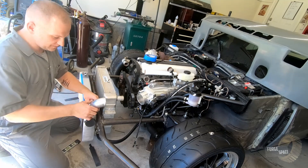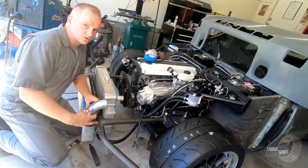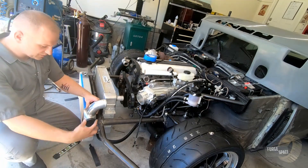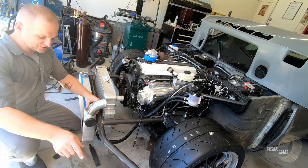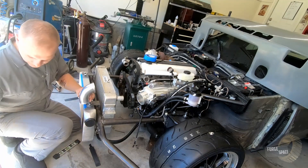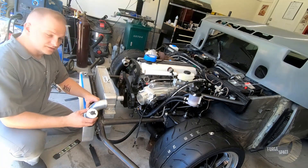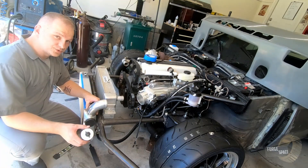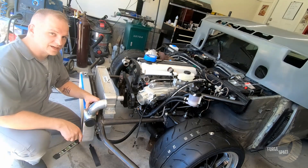We're going to put the bead on it — already got that, it's all prepped and ready to go. What I'm going to do is put the vacuum right on here and just let it suck the air out so as I'm drilling into this with the two and a half inch hole saw, it's sucking all that debris out. Let's go ahead and do this and we'll keep on going.